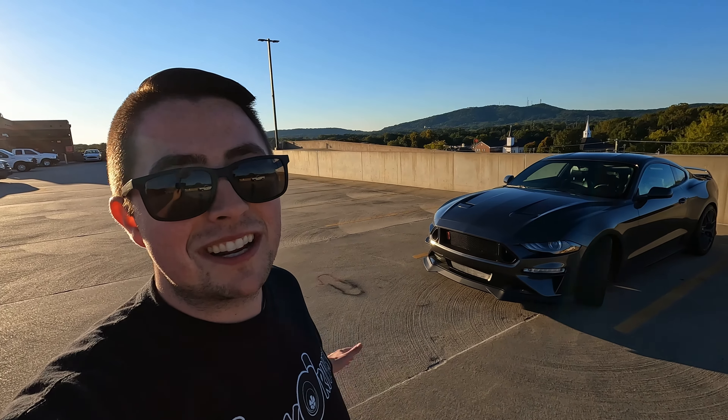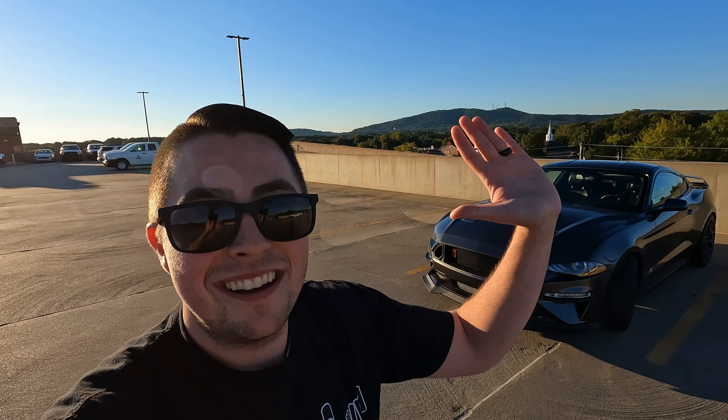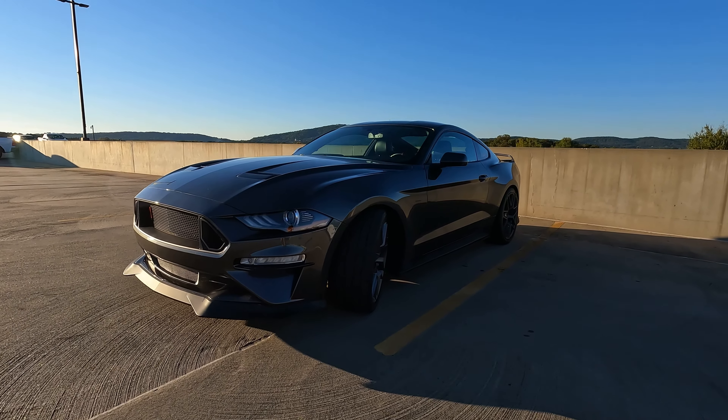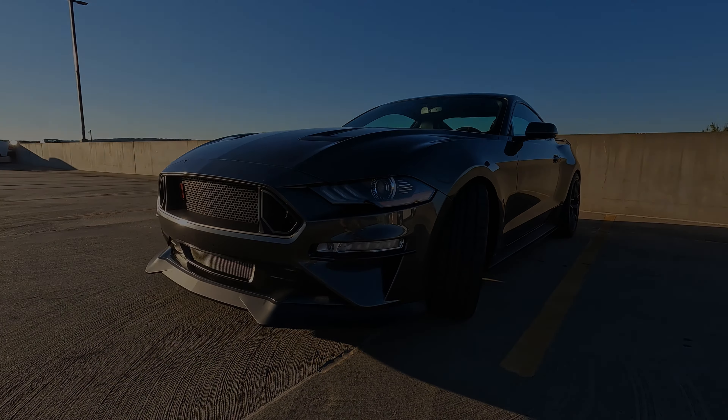We're good - don't look at my engine bay because it's dirty. The first thing we're going to do is pop off this radiator cover - there are just a few clips on top. Radiator cover is off. Now that the bolts are removed from the top of the radiator cover and the front part of the bumper, I'm going to take off the front wheels so we can get easier access to the bolts in the front section of the bumper.